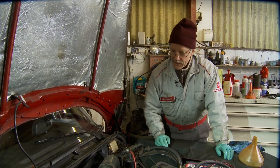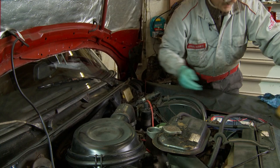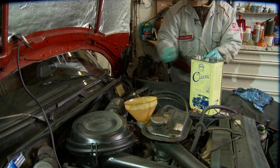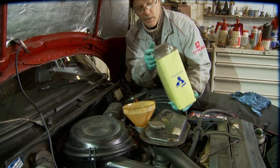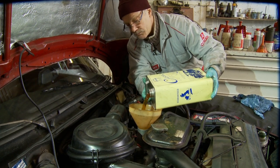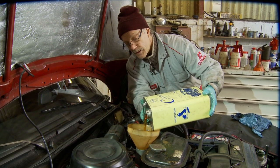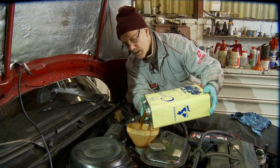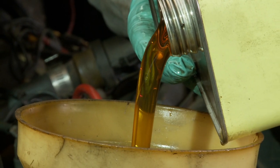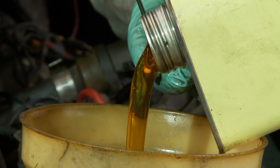We've changed the oil and filter and now I'm just going to top up the oil. Take off the oil cap — it's best if you use a funnel. The book says it will take five litres once you've changed the filter. The engine was designed to take 20-50, and that is the oil you can use if you get it. But you can also use a modern equivalent — I use a semi-synthetic 10-40, which Citroen will specify for hot countries, but given the vast improvement in modern oils, I've found no issues with using it.